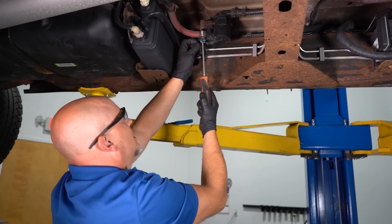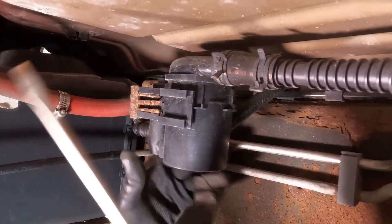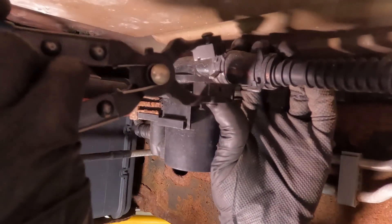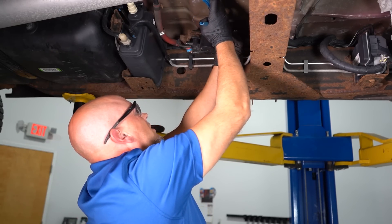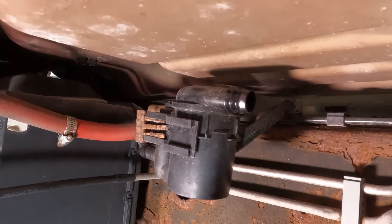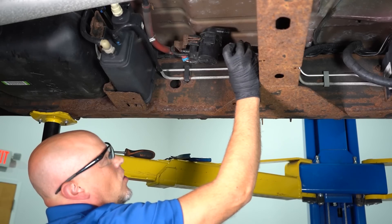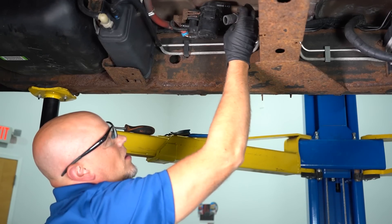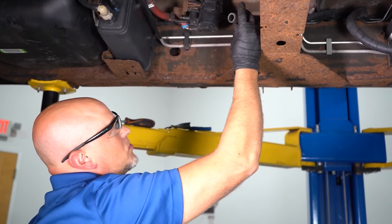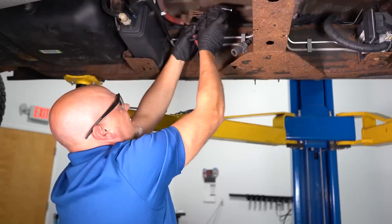It's very simple to take off. Normally there's a clip here or a clamp — not necessarily a worm clamp like this — just disconnect that and then a couple of hose clamps. Use some hose clamp pliers and slide it off. Now one thing you want to keep in mind: sometimes spiders do get into the fresh air side of the hose and clog it up, and that can cause a check engine light. So when you take off the fresh air hose, you want to blow through it with some compressed air and see if it blows through smoothly — otherwise you might have a spider in there. Disconnect the connector — again, it's just two wires — and it slides right off.